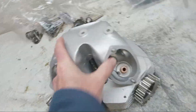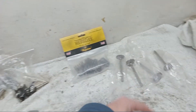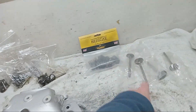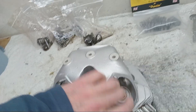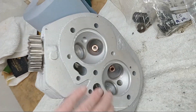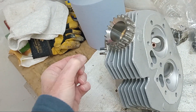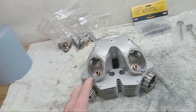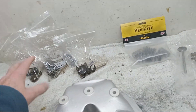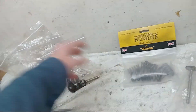The head's all brilliant, it's done and ready to be reassembled. We've got new valves and springs that were supplied by the engineers, because obviously they use the valves to recut the seats and make sure everything fits perfectly. I'm really pleased with it - it's a fantastic job. I just wish the customer service was a little more friendly. So what we're going to do now is use all the old collets and spring seats and put the new valves in the head.